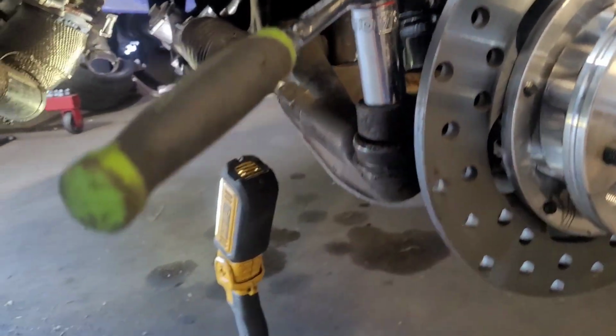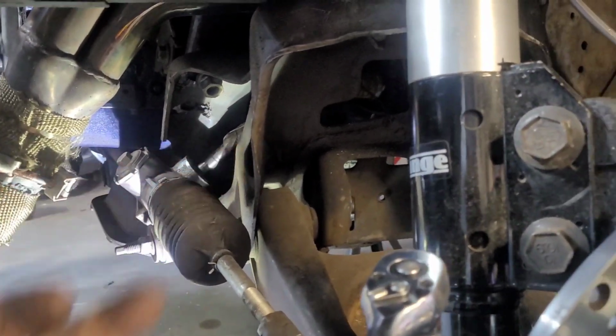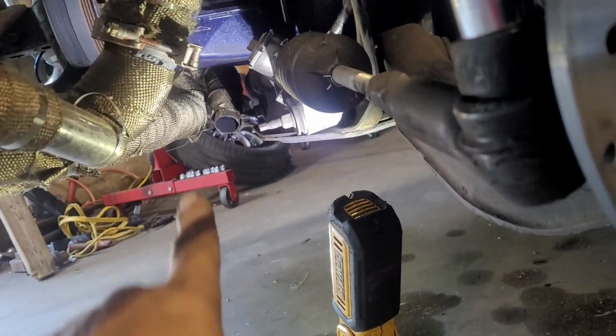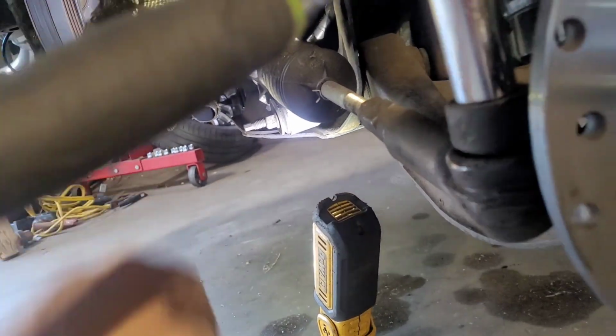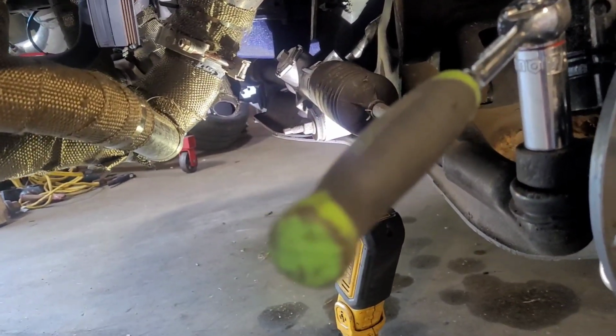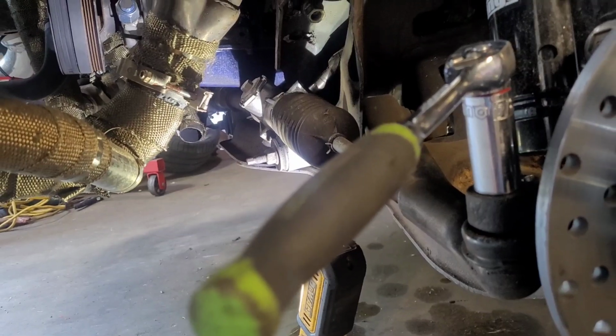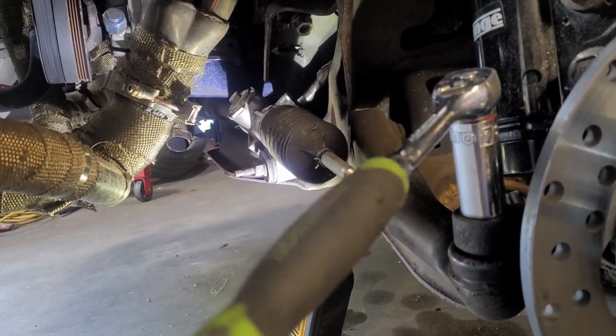We're gonna get this broke loose. Going to dig that side off. I already got the Borgeson loose, so I've got to knock the shaft up off of it and take these bolts out. I may have to remove my wastegate dump. I think it might be in the way of getting it out. We shall see. I should be able to knock that bolt backwards all the way through. I do know I'm going to go find a bolt to mount that rack on, because I don't have it, because stock's clearly not going to work, but that's not a big deal.